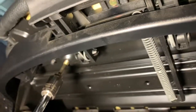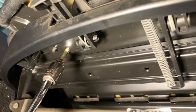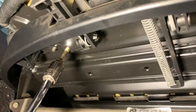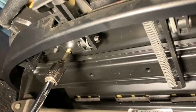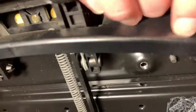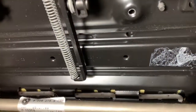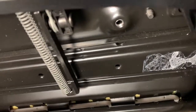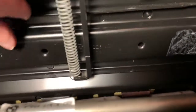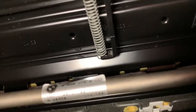You can see I've got the tap right there on that hole. That would be the inside of a U.S. E46, the driver's side, towards the center of the car. The second hole — I'm not sure if I can spot it here — it should be right about there. There we go, you can see it. The third hole I haven't gotten there yet. It's going to be a little harder to tap because of its location — it's right here in the middle, right above this bar. So I'll need to figure out a way to get to there.